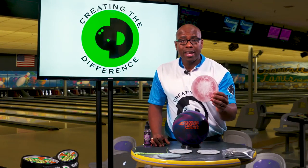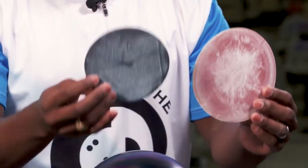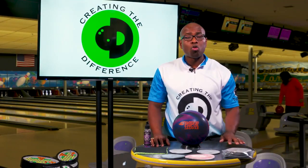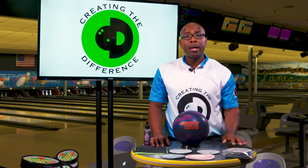This pad here is similar to what the manufacturer uses and is 500 grit. This pad here is also 500 grit but it's the TrueCut pad. They don't look the same and they don't cut the same — that's one of the big differences. With the TrueCut pad system, you can go right to the final grit number. You don't have to do that 500 grit step because you'll be able to get to 2000 grit by using the TrueCut pad.